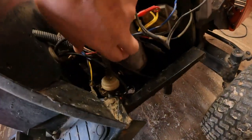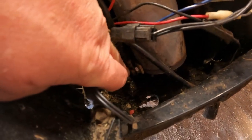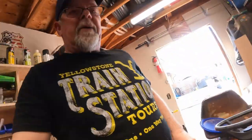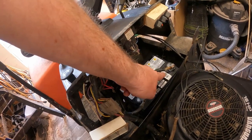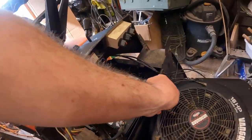Before I bought the battery, I jumped directly here on the starter and the starter turned over the motor. So I knew the starter was good. I could hear the solenoid clicking, so it was good too — which tells me the battery was bad. Obviously bad. I needed some better connections. Cleaned everything up, bought a new battery. That was our problem.